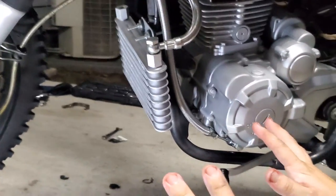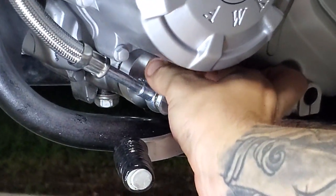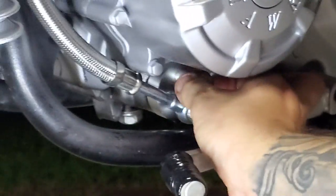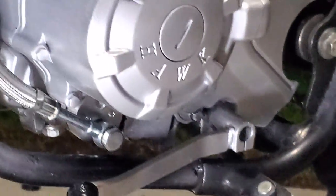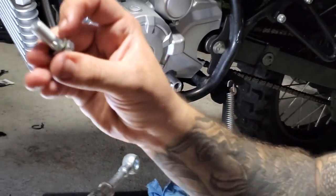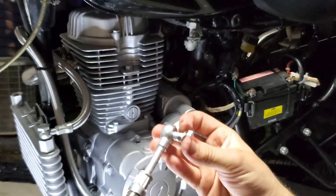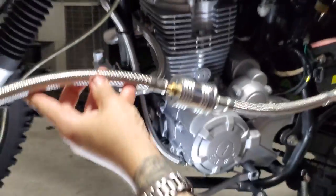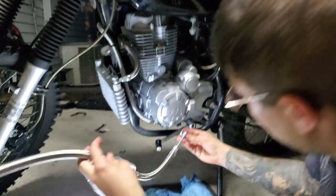Now we've got our first line down. Come to the bottom where we first put our plug in — we're going to be doing some close-quarters work again. Unscrew this right here and begin the installation of your return line. Make sure you have this washer on the small side of your oil line, and now that we've got it all assembled — all three parts — take the other washer and begin screwing it into the top portion.